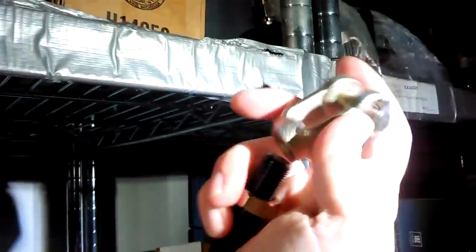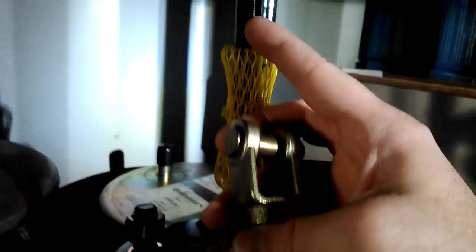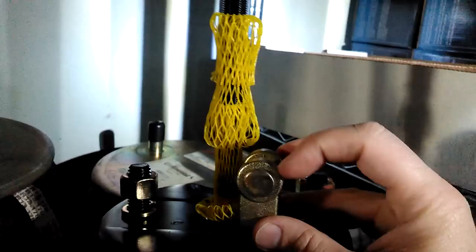Then you're going to run the clevis on. The clevis usually comes attached to these things. They usually take the nut off and put the clevis on bolted. This goes on the end at the top of the threaded rod. The length has to equal up because the center of this pin is where your old brake chamber was. If your older clevis is longer, you could make a mistake and cut this rod too short — don't do that. Make sure everything's correct to the new clevis; measure from the center of the pin and the length will be right.